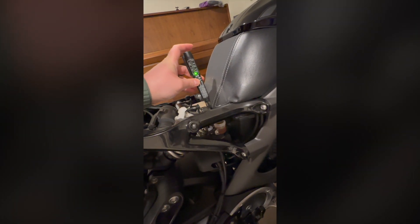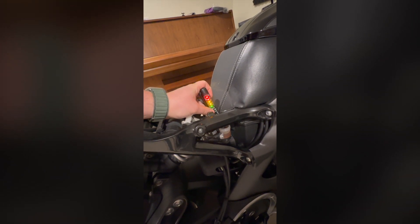Let's check the rear. The rear reservoir is much smaller and is controlled by a brake pedal versus a brake lever on the fronts. When I put the tester into the rear reservoir, it also shoots straight up to greater than 4% moisture. Also notice the color — it's like this amber, pea color. Brake fluid should be clear. So that means the motorcycle needs a flush.